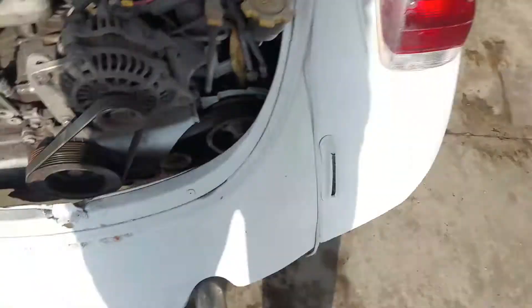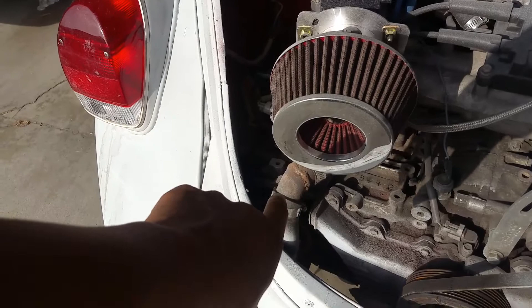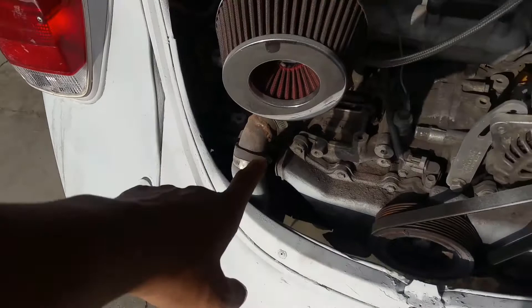In the back I actually got a filler bottle — an expansion bottle — from a late model Miata. I have the heater hose going from the top of the motor into the bottle, and then the bottom of the bottle is capped off. Fill it up to about half. You run the car, let the thermostat open, and keep filling it up as needed — it allows the hot air to escape and the thermostat to warm up properly. I probably should run it to the left to make it easier if I need to take the motor out, but that's how I ran my cooling.